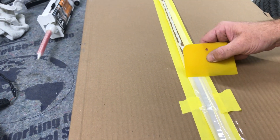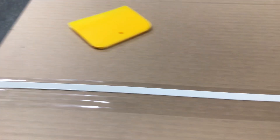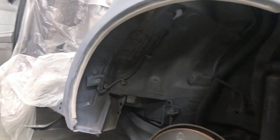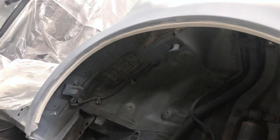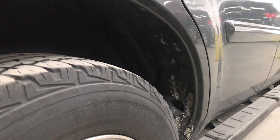Take the mud spreader and spread it out on the tape to get this ready. We're gonna use the seam sealer before it cures in the tip, get it on the corner — and this is what you get, this is the result. Use the 129 to stick it to the quarter so you have a perfect seam seal.